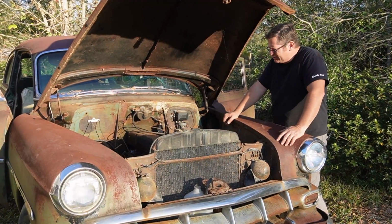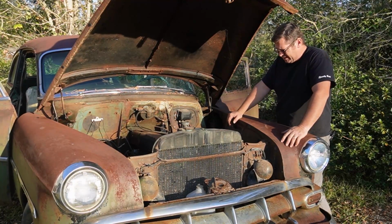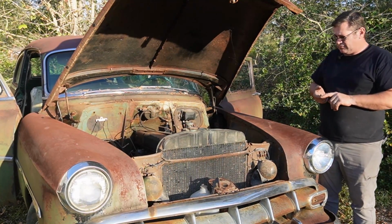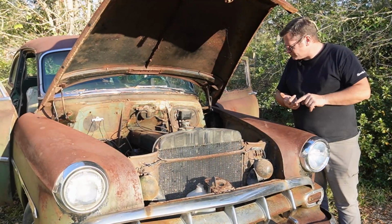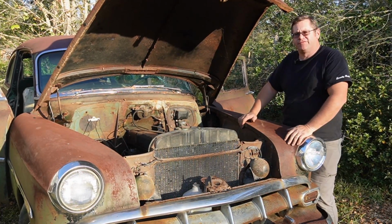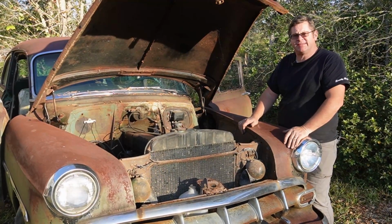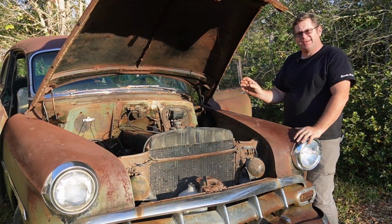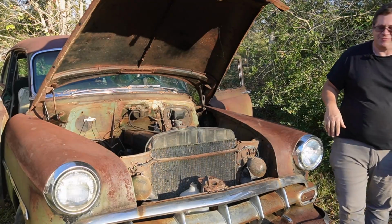Other known issues, man, I tell you what, it cranked right up every time. Carburetor, I think maybe flooded a little bit, but you hit that key and it fired right off. So it's going to be a matter of converting it to 12 volt. Figure out if we want to run an aftermarket oiling system, or just get new hydraulic hoses for the existing canister. And then we're going to put a Holley Sniper EFI carburetor on there. Absolutely, and a CNC aluminum head. The only problem with these motors is it has a Siamese intake port, so it shares a port in the middle, so it just doesn't get enough airflow.